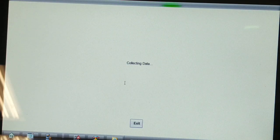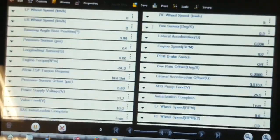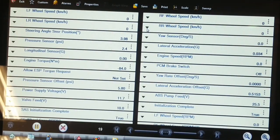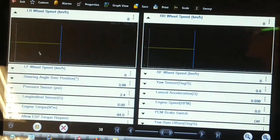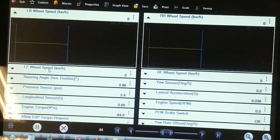It'll be interesting to see if I have a speed signal from the right side. I'm going to click on data and look at the rear speed signal. Obviously I won't have one from the left because it's not installed, but I'm curious whether I have one from the right. I'm going to spin the rear wheels.